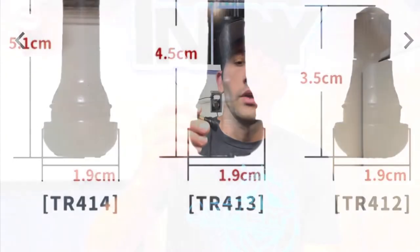I'm going to get to the next valve stem. It is a TR-600 HP — HP stands for high pressure, and I think the A stands for high pressure application. You will find these in three-quarter ton trucks, eight-lug trucks. I'm just sticking with cars and trucks for this video. I'm also going to attach a diagram right here on the sizing from TR-412 to TR-415.